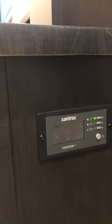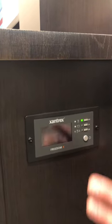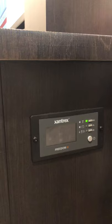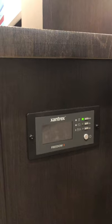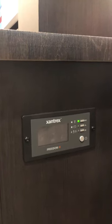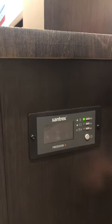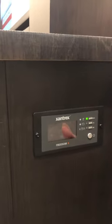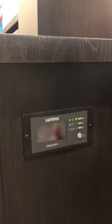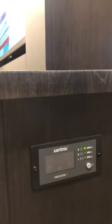Right here is your inverter. The inverter basically turns the 12-volt power into 110-volt, allowing your refrigerator to run while you're driving down the road. I recommend just leaving this on so if you happen to lose power at night or while you're not at the camper, you won't have spoiled food when you get back. It'll automatically run on the battery until you notice your lights dimming or until you get back. Basically, it takes over what used to be the gas side of the refrigerator — when plugged into 110, it runs off 110; once unplugged, it switches over and runs off the inverter.